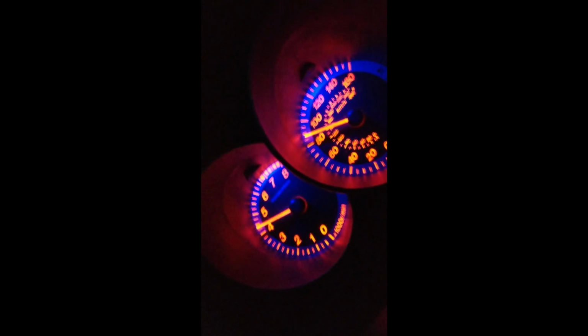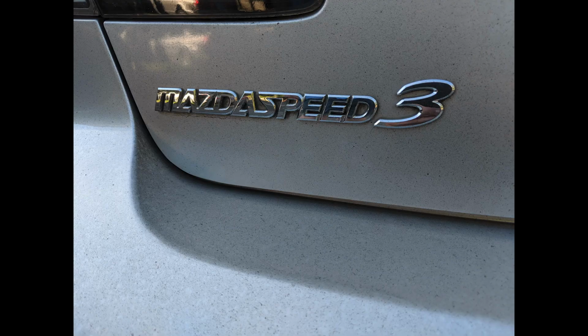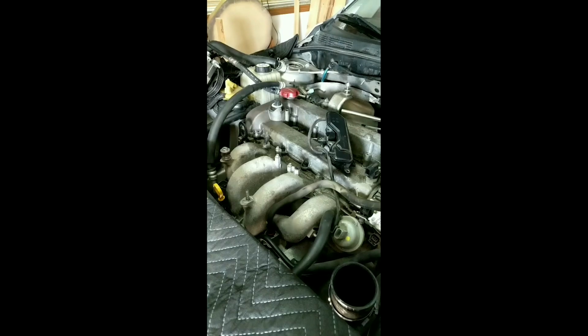So later in the video you'll see that I thought everything was looking good, but that was before I knew that the cylinders weren't even round anymore, which is really not good. Basically, it was running rich enough that it was coating the cylinder walls with fuel, so the oil wasn't able to do its job, and that's why there's that mirror finish on them, and that's really not something you want to see, and I didn't know that at the time.